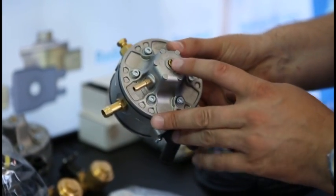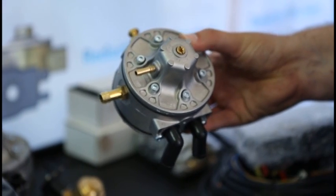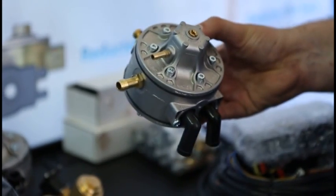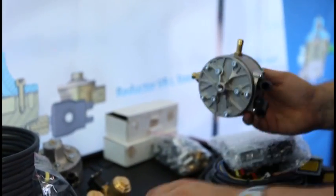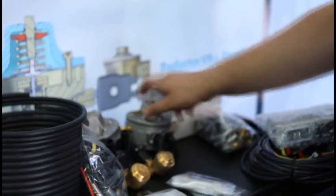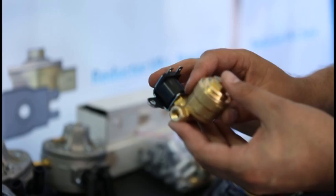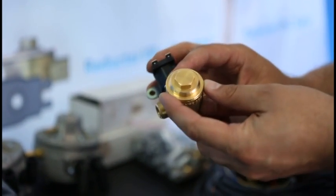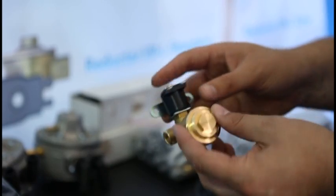There is the pressure regulation screw on the reducer. Reducers are regulated in our factory. The reducer's mounting hole. Before reducer, there must be the electro valve, where a liquid phase filter is integrated in. The liquid phase filter keeps most of the dirtiness out of the reducer.